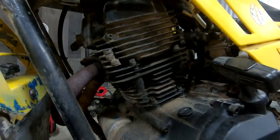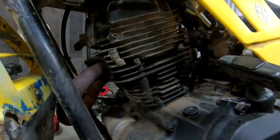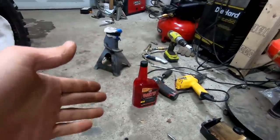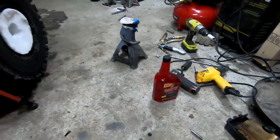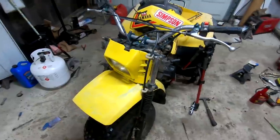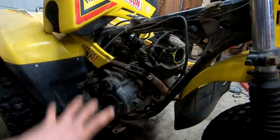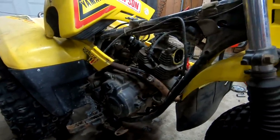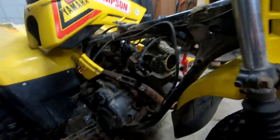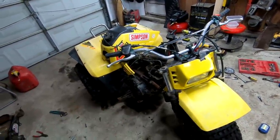It seems that adjusting the tensioner didn't really solve any of our noise — in my opinion it continues to come from the rocker arms themselves. So if you guys want to try out Marvel Mystery Oil, or you have used it in the past and have some experience, leave that in the comment section below. I like reading constructive, knowledgeable, entertaining stuff. Stay froggy fresh, stay super fly — I'm going to put this thing back together and we're going to continue to rock it with a little bit of tick, because that's what makes this thing sick. See you guys later.